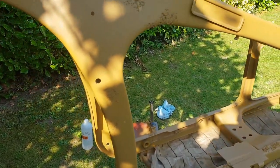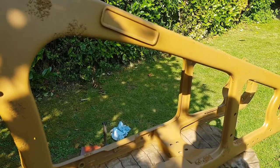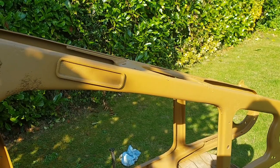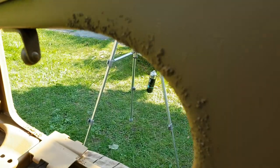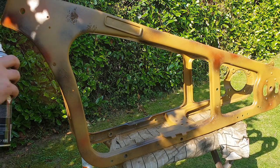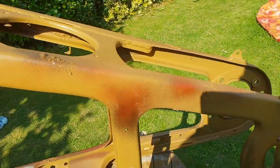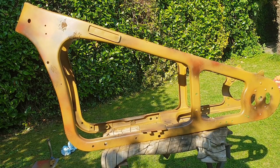It's all done now — completely painted. I'll put a zoom in so you can see how it looks. Next I'm going to let it dry for about 20 to 30 minutes, then put a few accents of black and a little bit of red, and finally mix some more top coat and give it a slight sheen just to detail some of the high-wear areas. And then finally I'm going to go over it with a very thin coat of paint — watered down by about 60% thinner.